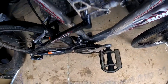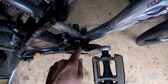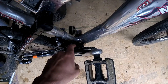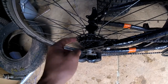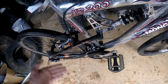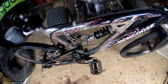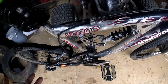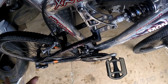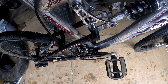What we have to do is go below drive — this is drive gear and these are two sizes below drive gear. That's final drive gear on this stack and this is six sizes below final drive. So we have a lot of variation, hence why it's called a 21-speed bike — there are 21 different gear ratios. Now a CVT system uses the same idea, except instead of a chain and gears, it uses what's called a variator and a belt.